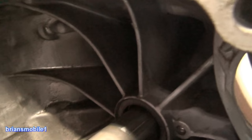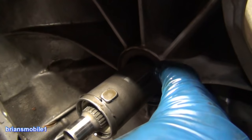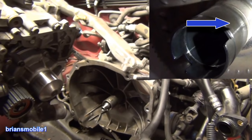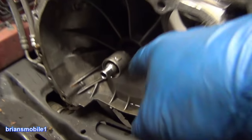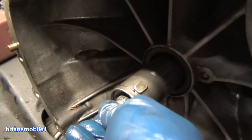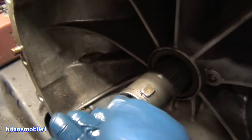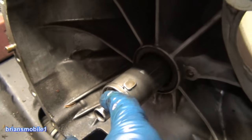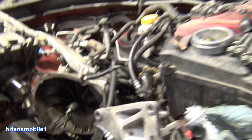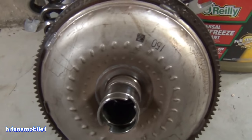You're usually about three layers deep and this is no exception. There's the transmission seal, the input shaft seal — it actually seals on the torque converter itself. So you've got to put it together and take it apart carefully. You don't want weight and pressure on this shaft here. If you bend this, you'd have all kinds of headaches and problems.